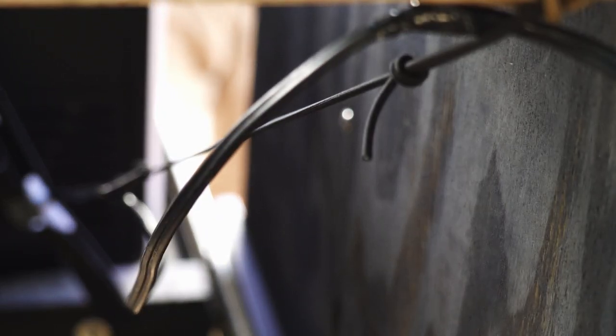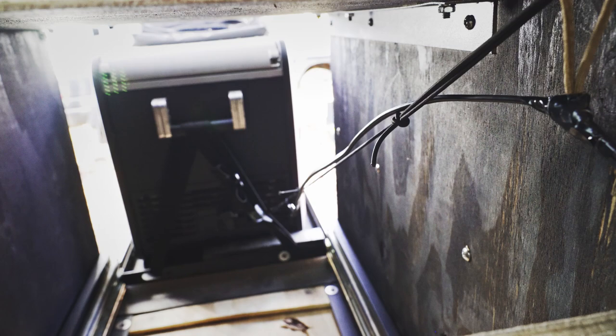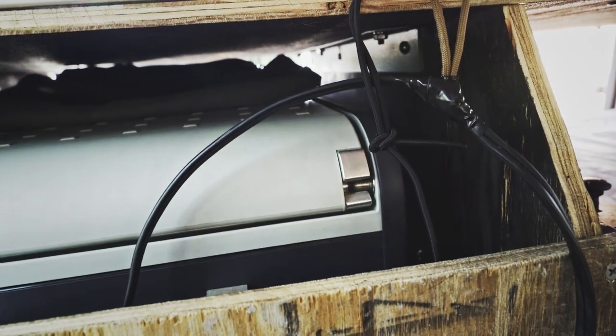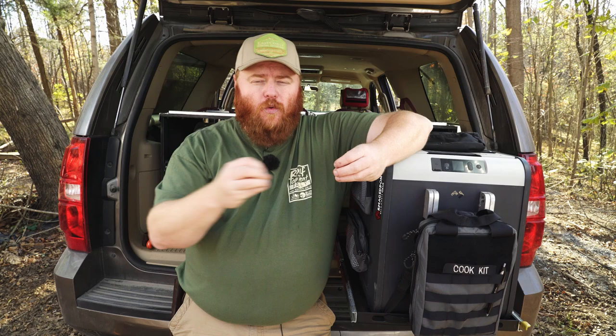When using a slide, cable management is important. The fridge needs to be plugged in but also able to move, so you'll have roughly one and a half to three feet of cable slack as it slides in and out. Make sure the cable doesn't get pinched in the slide mechanism or behind the fridge. A couple of tricks: use a bungee cord to keep the cable from going slack, or use coiled cables that spring back and stay tucked out of the way.